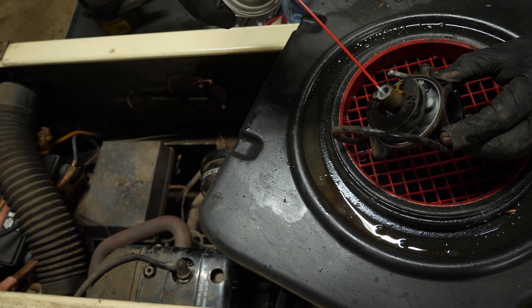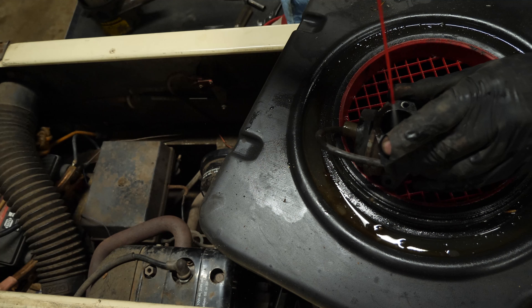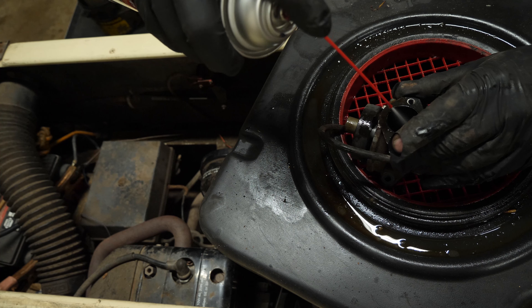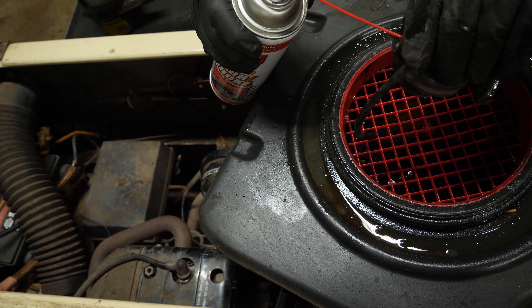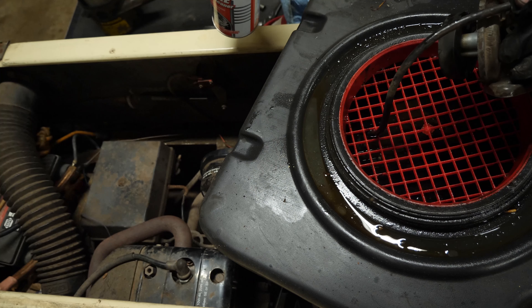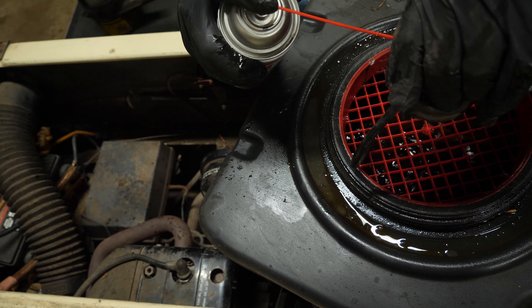When you see all the yellow coming off of your parts that you're washing, that just means you're taking all the nasty old gas off. And then to put it back together, it's exactly the opposite — I'll hold the main shaft and then screw in the center jet here. I really don't know the technical term for it — all I know is it comes apart and it needs to be cleaned. Now I'll shoot down the throat here, make sure that's good. I'll shoot down all the little ports here.